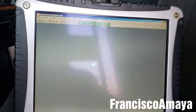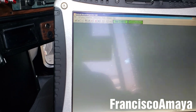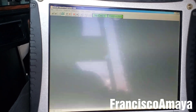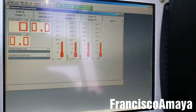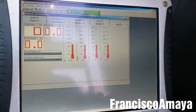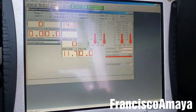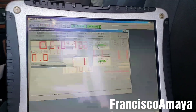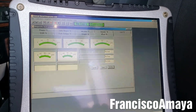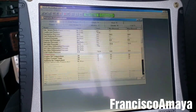I'm going to show you the old version DDL software. Over here you have your instrumentation where you can see everything — these are all the gauges: coolant, oil, air, and fuel. Nothing else. For the newer ones with EGR, you'd want to have the EGR over here. It's so simple — there are not many things to look at. Misfire is simple too. You can put whatever you want there and view all the data.